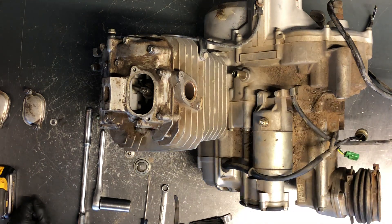Today we'll be doing a valve adjustment on a Honda FourTrax 300. We have a couple covers removed here already just to speed this process up. You do not have to pull this motor to do this valve adjustment — just clarifying that, so you don't pull your motor just to check your valves. You can do this while it's in the machine, everything hooked up.